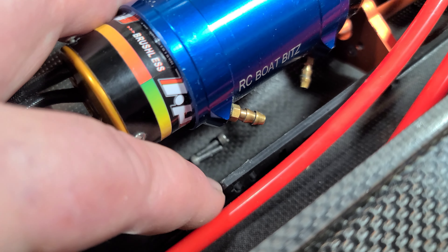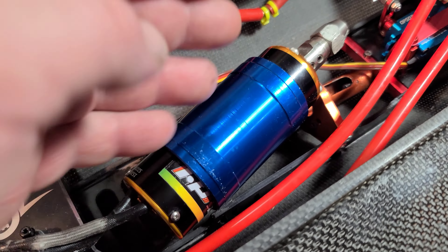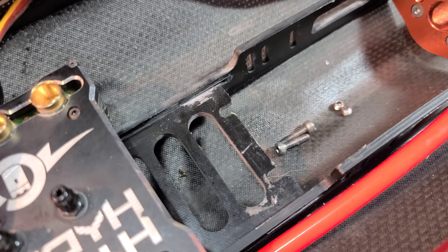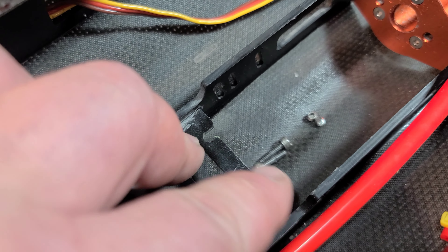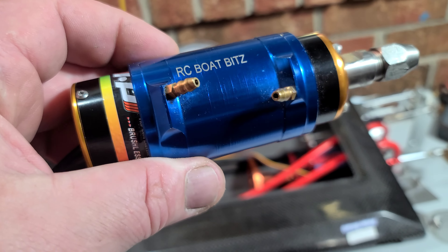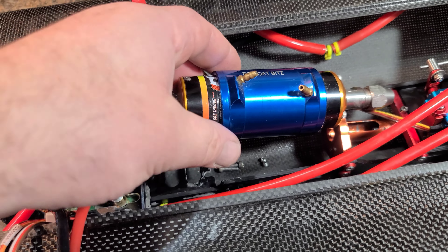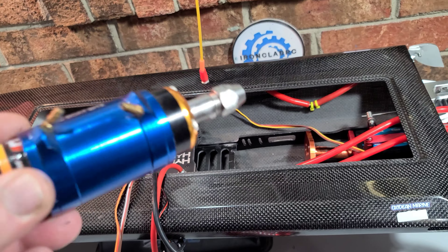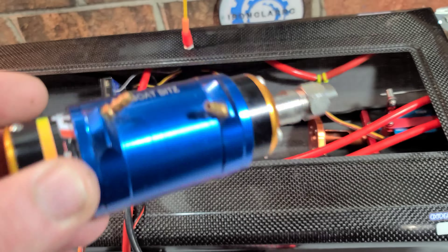With the 4070 you're not going to be able to get the forward support ring on that motor and run a long jacket like you need to — you'd probably have to cut that area of the ESC tray off. I don't really recommend the 4070. A 4060, on the other hand, is basically the same size as this 4092 and will fit in the boat perfectly. So if you're going big block in this boat, a 4060 is probably about as big as you can go.